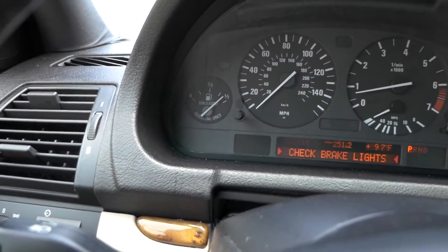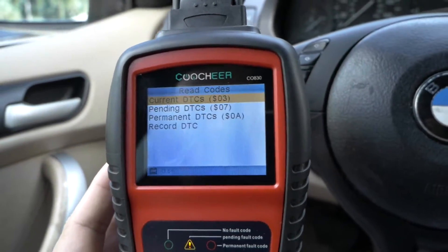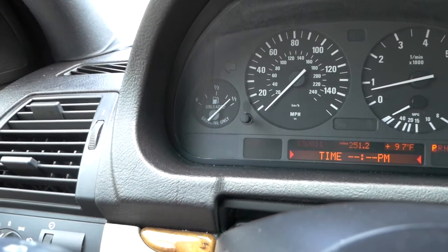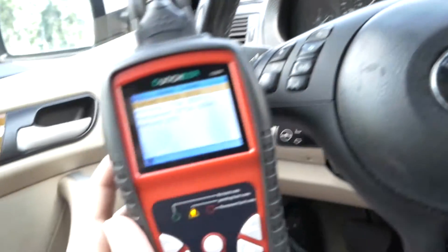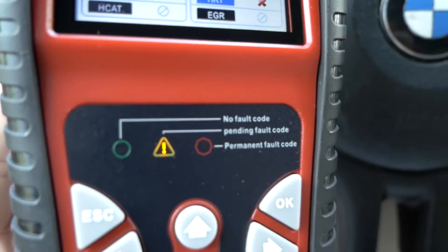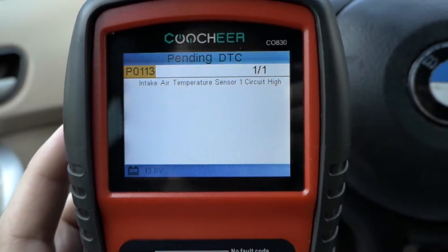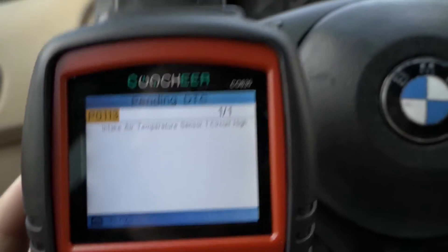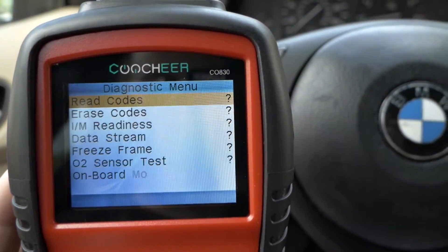If you have something like that, technically that could be fixed, but I'm not sure if this problem is going to come back. It's not there right now, so it's not an immediate problem. Looks like all the sensors work — maybe they just malfunctioned for a little bit, or maybe when there was a repair done they malfunctioned and never got reset. But they are gone now. Oh wait — we have pending codes. So we did not get rid of our problems, they're coming back. The pending codes triangle is coming back. Let's check that out — our pending code is the same thing: air temperature sensor. So yeah, we do still have this problem, and it will be coming back since it's pending. It's only a matter of time until it shows up as the permanent check engine.